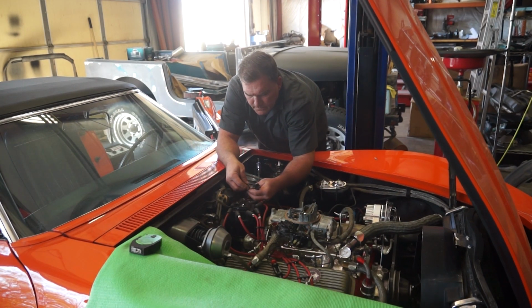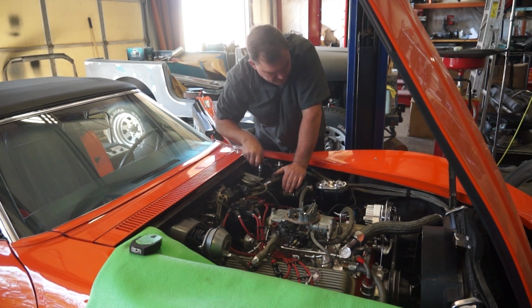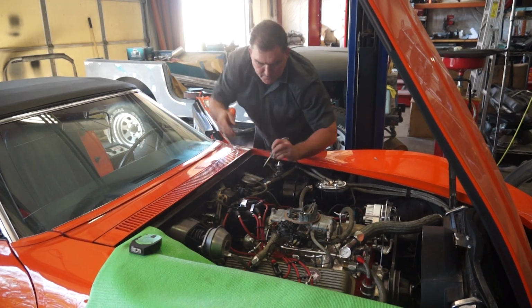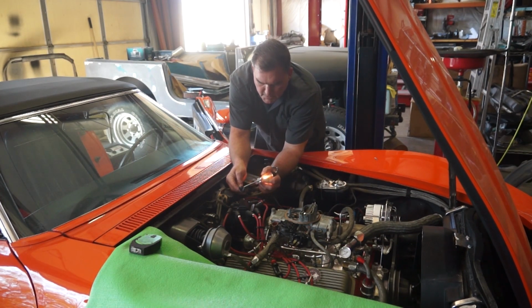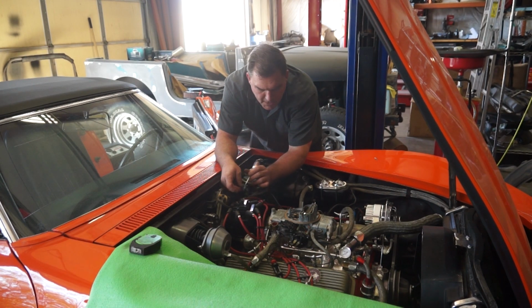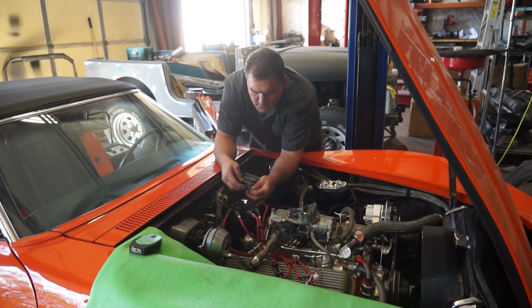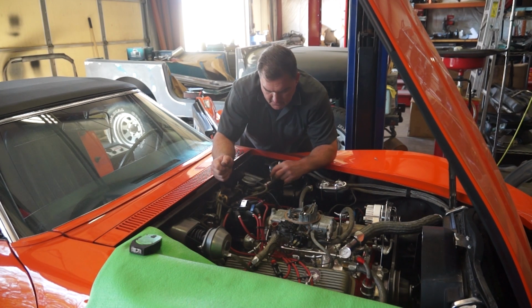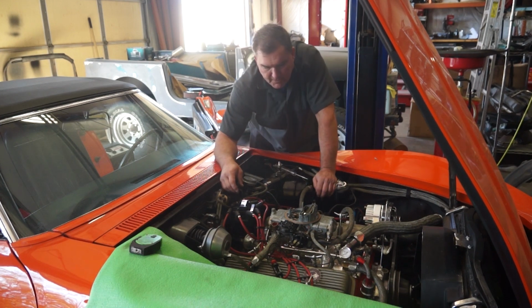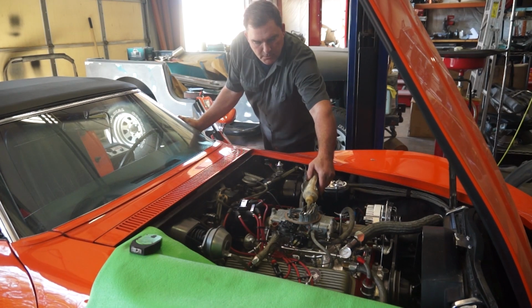Got my key on. That would be awkward. Ooh, there's my key on power. Okay. So I bet when cranking this loses power and that one, okay. So we need to wire it up correctly. That used to go to the dizzy. I bet he did have a hard time getting this thing to run after all that, because he doesn't have a key on power. Let's fix that. Let's see if that works.